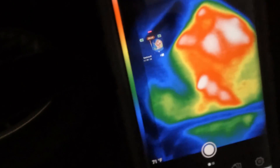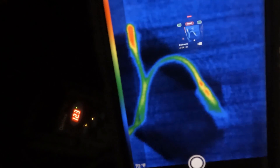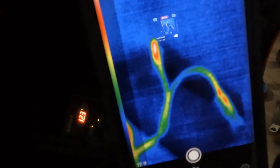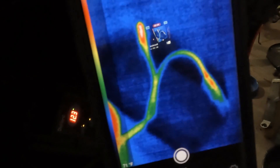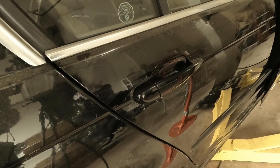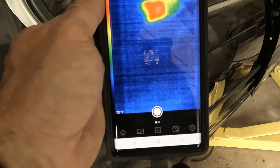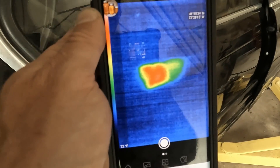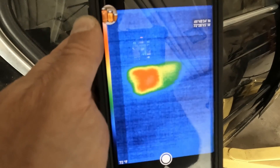Here's another example — I'm in my trunk and it's super dark, but there is my battery charger outputting some heat. You can see I am outputting some voltage to my battery during charging, so this would show up as a draw just using a thermal imager. Here's a common cause of a parasitic drain on a BMW: the comfort access door handles. There's my door handle lock cylinder where my module is, and it shows up as a parasitic drain right on the handle.